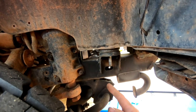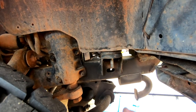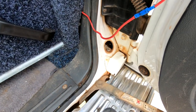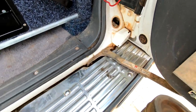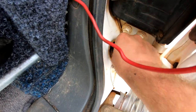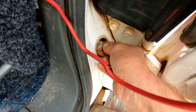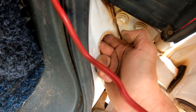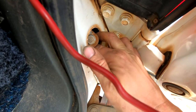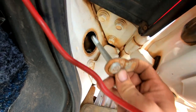The ones I've done before I've just pushed straight up, but this one the arm's facing backwards and hitting against the chassis — I think it's meant to be facing forwards, so Mitsubishi may have stuffed up there. For this back one, I took the bottom rubber off to give more movement. If you try to get it up through the hole it's not going to happen — you need to put it up inside the body and then work it out through the hole.